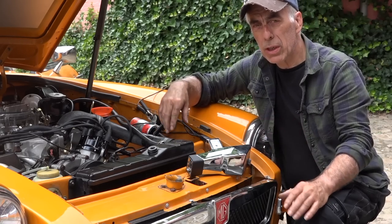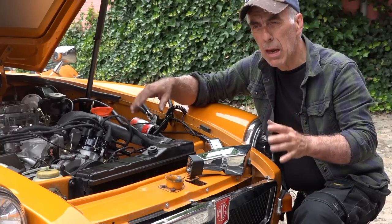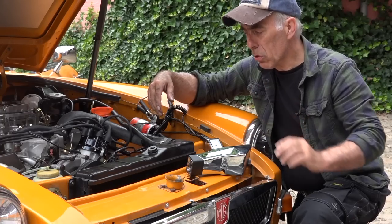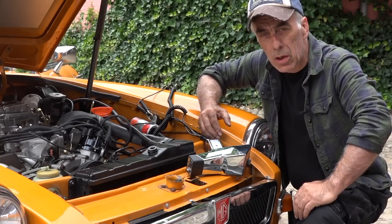That's something for later. You can check it later on with the vacuum hose on, and then you give some throttle up to 2000 RPMs, and then you can see how much advance you're getting. You should see more advance happening with the strobe light. So let me try to crank the engine up and then have a look on where we are actually with the current setup.